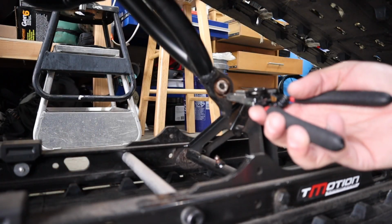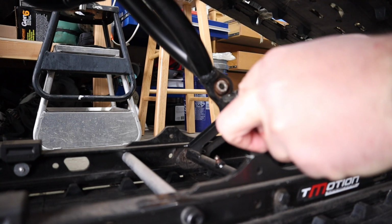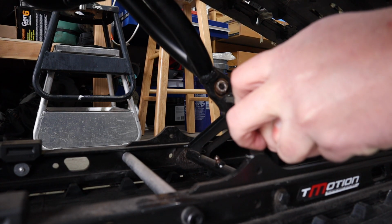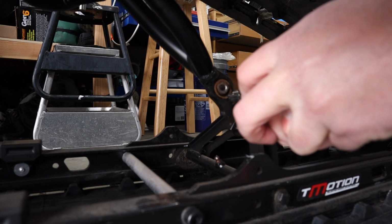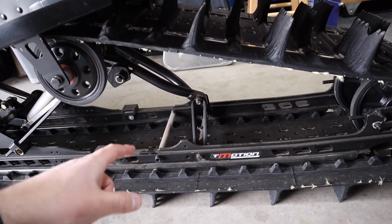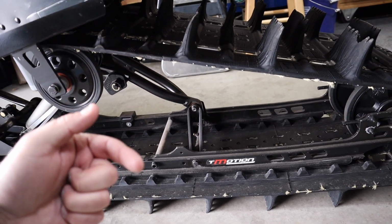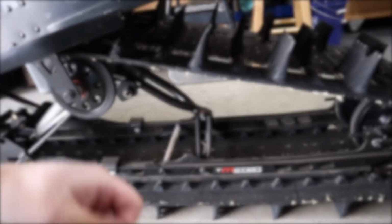And it's a very difficult process not having anything to back up your pivoting arm right there. So I'm going to try the old socket screw or socket and bolt press method. We're going to see if that works. If it does, it will be a very easy method to press the old one out and push the new solid piece in. So let's give it a shot.